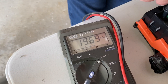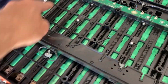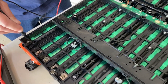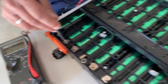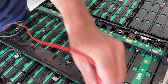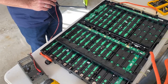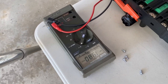Now it's a little odd because this battery pack is not fully charged. Each six-volt half of one column is only at about 5 volts due to state of charge. But as we start to measure different parts, you see multiples of that 5 volts come to life. Put four together and you end up at about 19 volts. The whole pack end to end is 119 volts. We've been careful all along not to touch those two ends simultaneously — just like sticking your finger in a light socket, it would be quite a jolt.